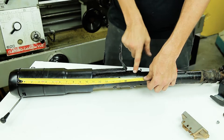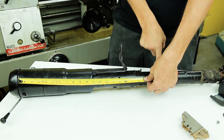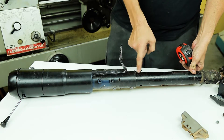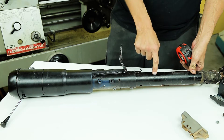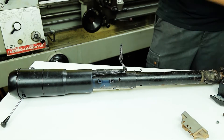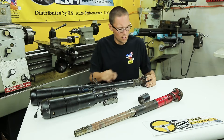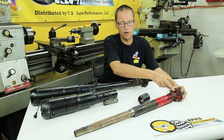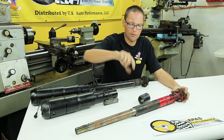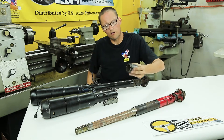There's a parting line in the steering column at 17 and 3/4 inches. We need to cut the lower half of the column at that seam — only the outer tube. Then this outer tube and inner assembly needs to be pulled apart. Now that you've made a cut to the lower portion of the steering column, you'll need to hammer it out quite hard and what it will end up being is all of this coming out. There's a piece left over inside the upper half of the column that needs to be pulled out as well.